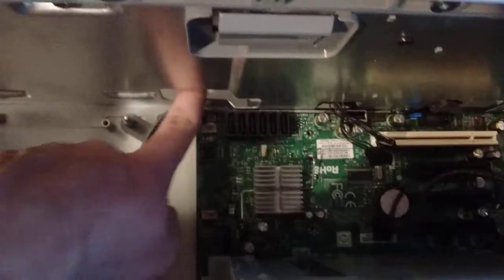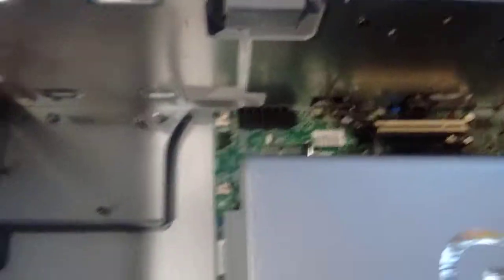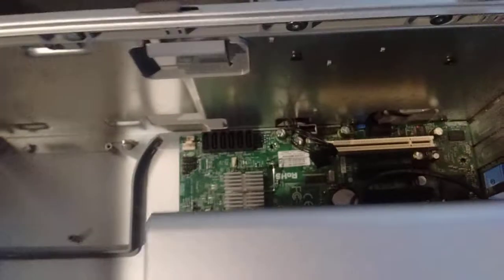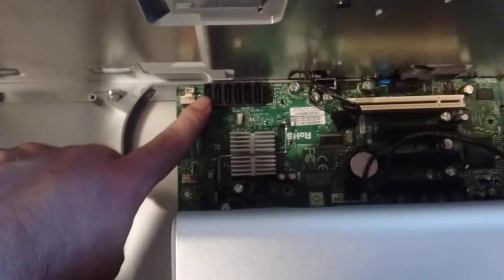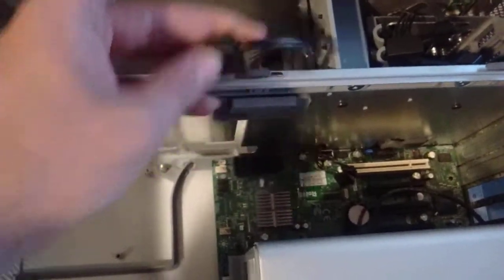I'm gonna use the original supply, so the original drive cabling can stay. The SATA cables, however, I'm gonna have to route differently. I'm actually gonna use one of them for the optical drive, because the SATA ports are right here. I'm just gonna pass a SATA cable right through here for the optical drive, and I'll buy a black Molex to SATA adapter. For the hard drives, the original cables don't reach, so I have to get a cable from somewhere. I found it — this cable is exactly the same SATA cable, the termination is exactly the same, except longer, because it came from an iMac. It has the Foxconn part number and the Apple part number.